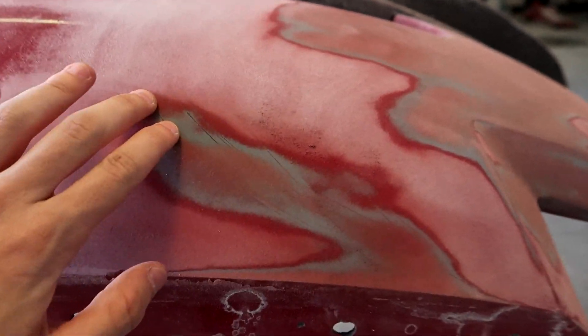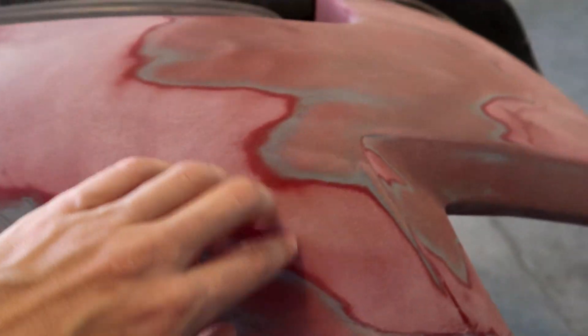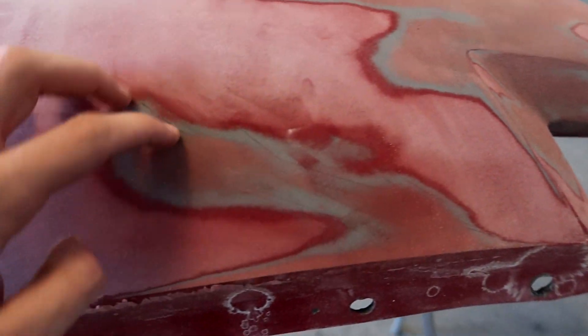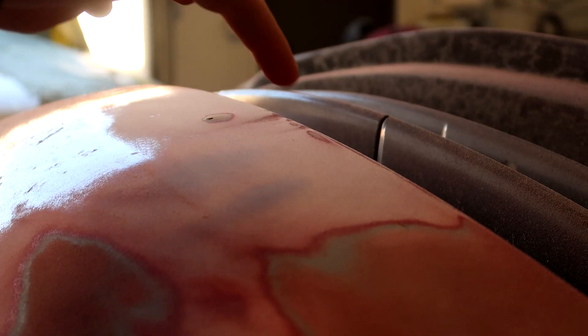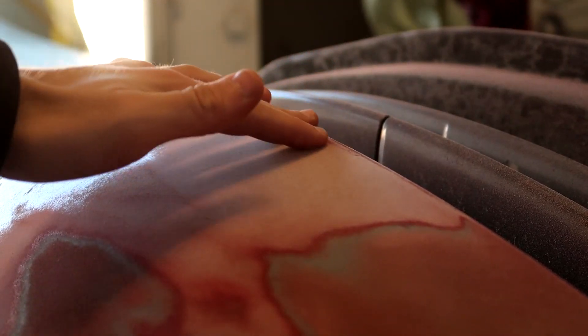As I sand down some of this clear coat, you can see the cracks come through. As we sand it down more and get it down to this orange — this is the actual plastic — the nice thing is the scratches don't actually go that deep, so we got most of them on this side. You can see we have some rippling, so I'm basically going through and trying to smooth it out so we don't have to put much Bondo in. I think we'll be able to do it.